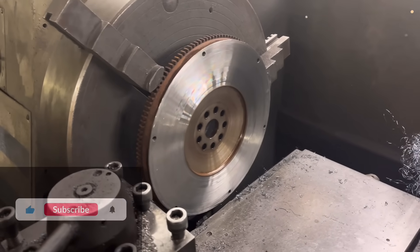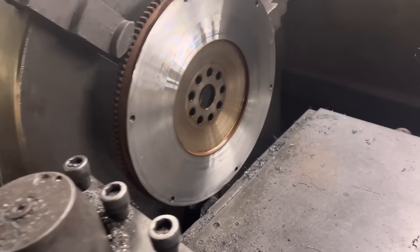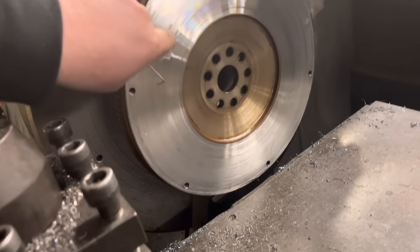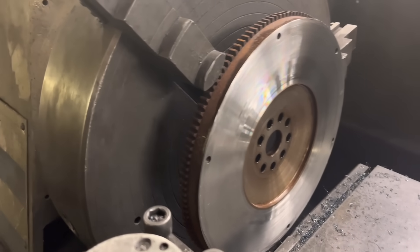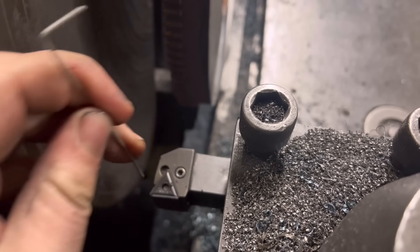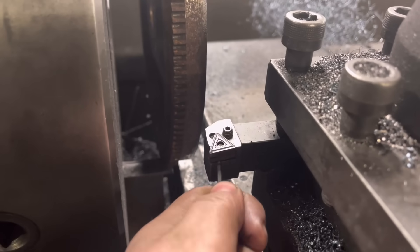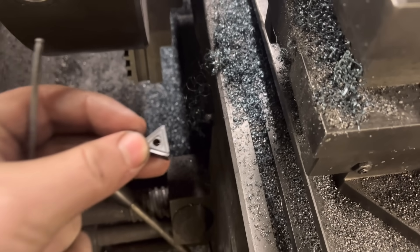I just thought I'd show you what I'm doing. I've got this Cosworth flywheel up on the lathe here and I've already taken a couple of cuts. You can see in these areas they're all hard spots — sort of all around that central area where it's a bit distorted. They're quite bad in this one. I'm just going to change the tip — just quickly dig out all the swarf in that Allen key hole, undo that, and that's popped the tool up.